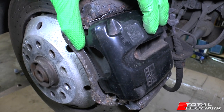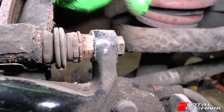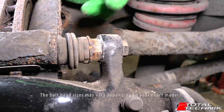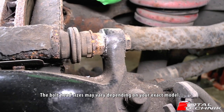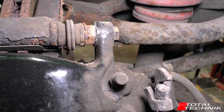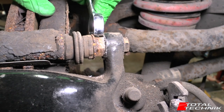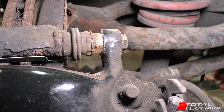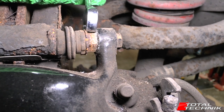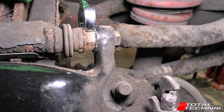The first stage is to get the actual caliper itself out of the way. There are two bolts that hold this on. If you look at the rear, you'll see two nuts — one on the rear and another that sits just on the inside of the caliper frame. These are size 13 and size 15. If you use a normal spanner you'll find you struggle to get it in width-wise, so on some models like this one you may need a specialist thin spanner. You can get a normal size 15 in with a gentle tap, but a thinner one is the ideal solution.